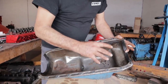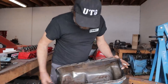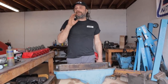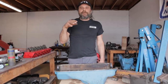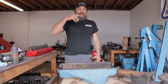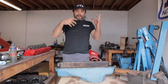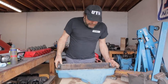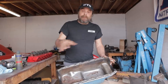The idea is to delay it long enough for the oil that's coming down off the front of the crankshaft to drain down to the sides and replenish the sump. Then we decided we need a windage tray in this thing too, because windage is a serious horsepower robber. On an engine like ours — 300 to 350 cubic inches, 350 to 400 horsepower — you can see 15 to 20 horsepower loss through windage. Windage is where oil coming off the spinning crank gets caught up in a cloud, and the reciprocating assembly — the connecting rods, crankshaft, counterweights — all have to fight through that cloud, and it robs horsepower. So we figured, let's kill two birds with one stone: instead of building a separate baffle and adding a windage tray, let's just make a combined baffle slash windage tray.